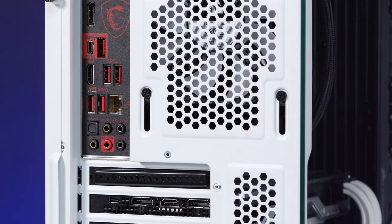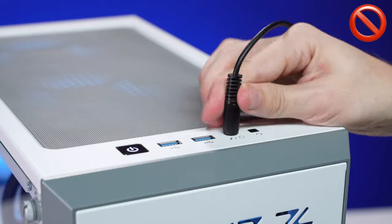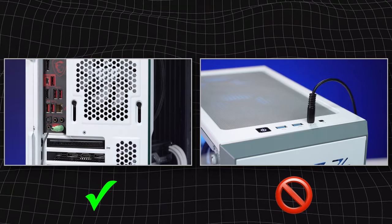One thing I want to clarify, because I'll be mentioning line-in ports a few times in this video: a line-in port is the analog 3.5mm port found on the back of a desktop computer on the motherboard. When a capture card has an analog 3.5mm input port, this is also effectively a line-in. These are different from a mic-in port, which would be found on the front of a desktop computer or on a laptop. The mic input only supports mono audio, so you can't receive the full stereo signal through that port.